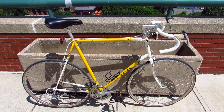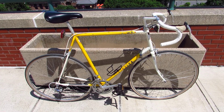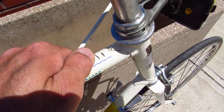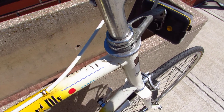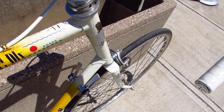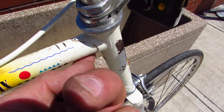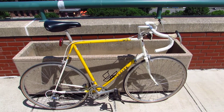Does that mean anything? Well, it's a steel bike and chances are you could ride this thing for another 50 years and not have any problems - but that's up to you, because you could be taking your life in your own hands. This is stress. This is wear. This thing could snap off and then you'd literally die. So if you get an old bike, or if you're looking at a bike, and the front wheel is warped or wobbly but the back wheel isn't, and there's some stress lines in the paint, maybe a little bulging - be careful, because that means the bike has been whacked in the front.